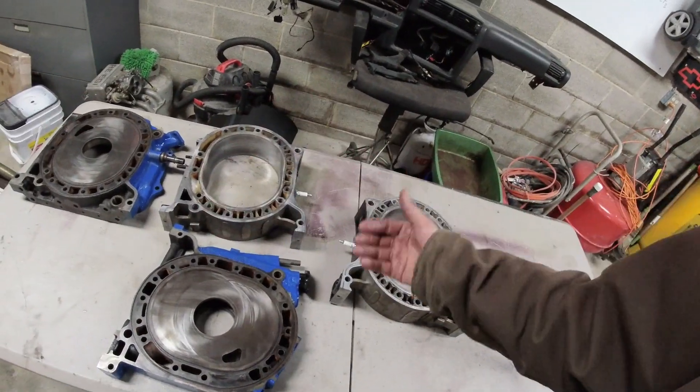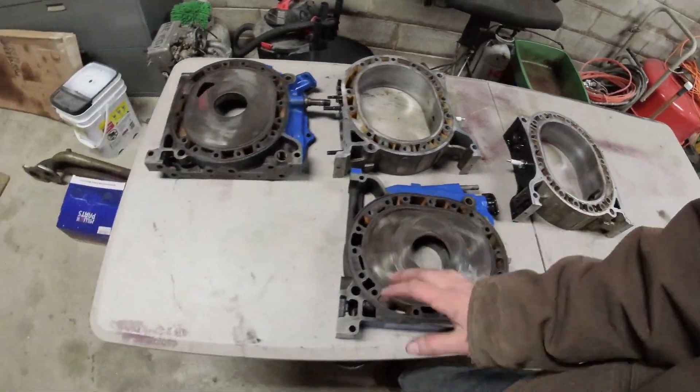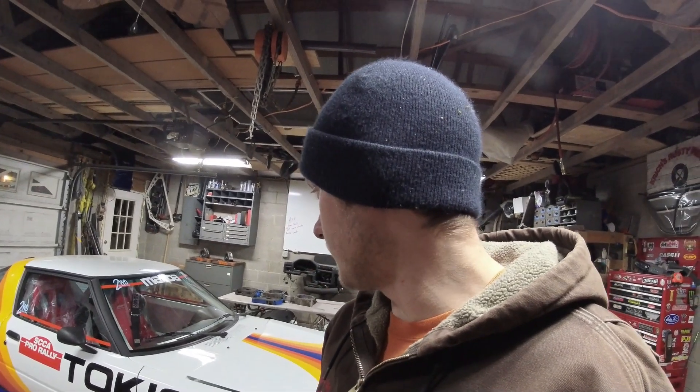Preemptively, I've glued the seals together. I cleaned all the hi-tac off this engine — hi-tac can be a little pesky; brake cleaner is your friend, but don't tear up your paint. The housings are all cleaned up, there was no damage done to the housings or any of this. So we're ready to stack this thing back up. I've got the heat going in here. Also, this week is rally car for sale week, so if you haven't checked out the rally car auction, go check it out.